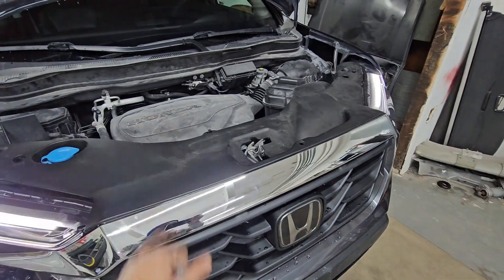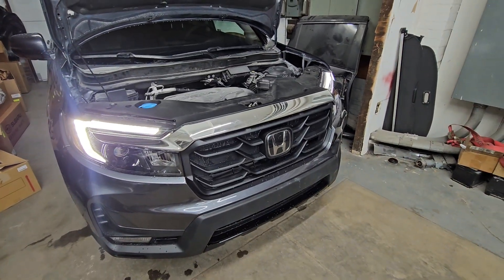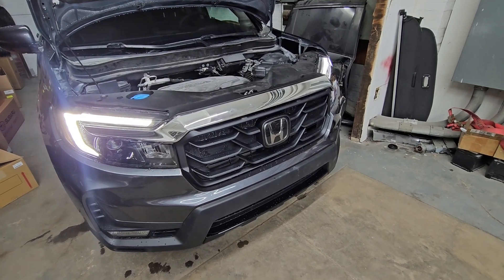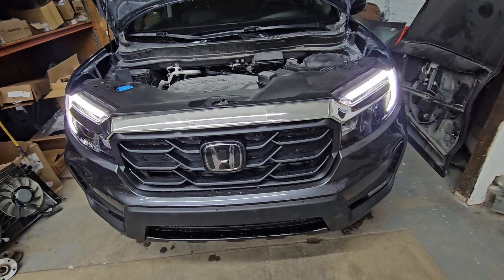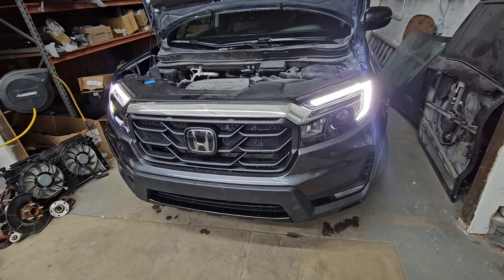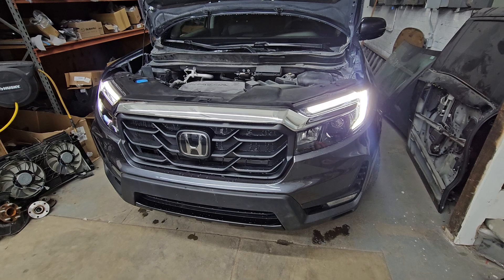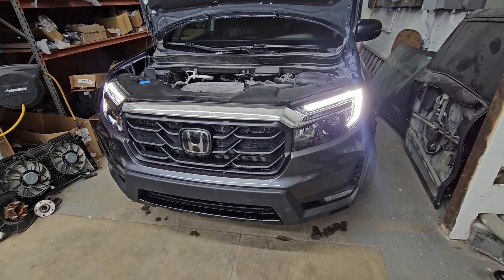I just want to share this quick tip because I've had this happen numerous times when I replaced the fans, got on the road, it was blowing cold, and then I'd stop at a light and it's blowing warm air. That's what it was — sometimes when they put these fans together, they just mess up the polarity on the plug and it plugs right in, giving you that problem. Thanks for watching, this was George from Melnix Automotive.